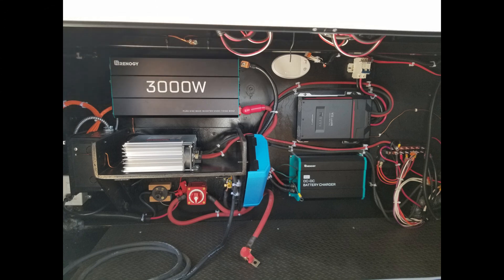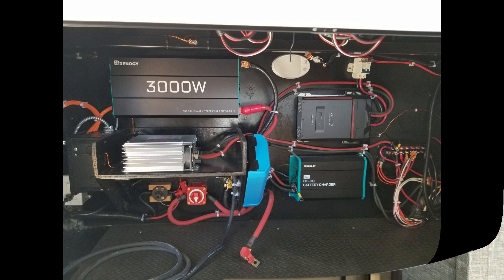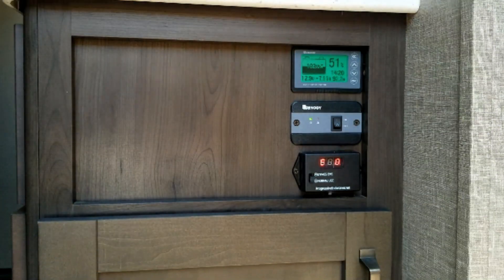So to give you a better idea of my setup, these are the components. That is my bus bars and fuse holder. That is where the battery monitor shunt is located. That is the battery disconnect switch. That is my automatic transfer switch. And of course, that is my inverter. Inside the trailer, you can see my battery monitor and the remote switch location for the inverter.